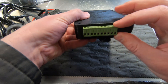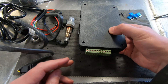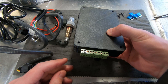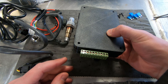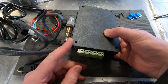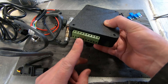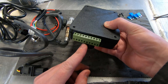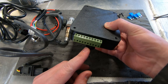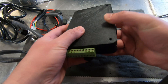On this side there's a wiring block — this is the Mega Spartan. The reason I went with this one is partly because I wanted to try the 4.9 Bosch sensor, but also because this one directly wires to the Mega Squirt. Two of the wires will go straight to the CAN bus, and with configuration through Mega Squirt it should read directly as a CAN bus input.